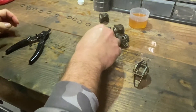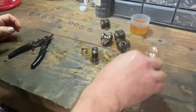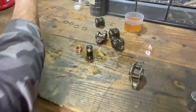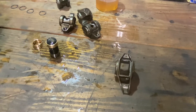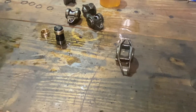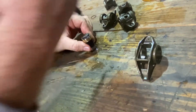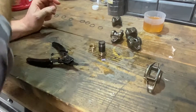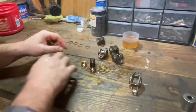That's the only thing really wrong with this rocker assembly. I mean, these rockers are very stout, very strong pieces from the factory. They can handle big horsepower applications with no trouble, as long as you get rid of these needle bearings — you'll be fine. And this is the same kit — it says LS on here, but the same exact kit you could put on LT. It's the same stuff.